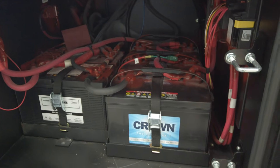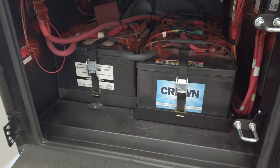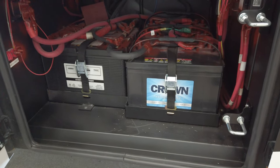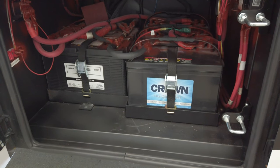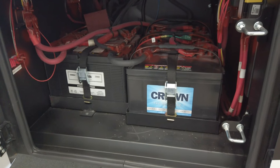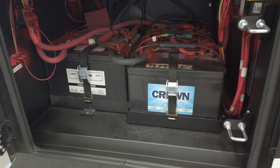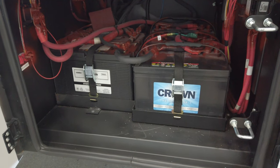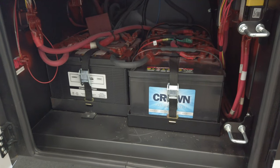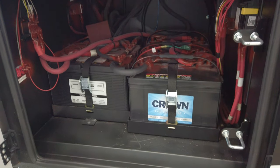In the bay closest to the driver's door, the chassis batteries on the left fire up the main chassis engine, and the coach batteries on the right power the coach. Those two systems are completely separate, but you can tie them together. If the chassis engine batteries died, you could jump start off the coach batteries, or vice versa for the generator. You've got solar on this coach charging these batteries. Hooked up to shore power, you're charging your batteries. The generator can also charge your batteries, and it's got auto gen start features — we'll talk more about that inside the coach.